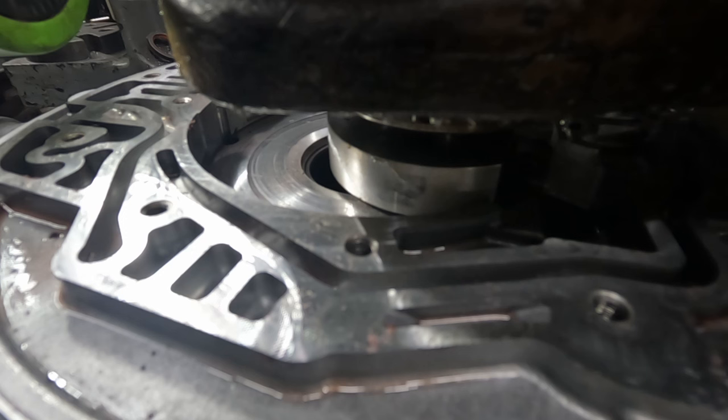So it took me a little while to try and position the camera in a space that we'll be able to see stuff, but there's not a lot of working height on these Van Normans. So I've got to keep a really short squat fly cutter, and then of course that's down in a pocket, so it's kind of hard to see, but I think we're going to get it here. So let me turn on the mill and try to touch off to find a zero and probably add maybe 4 or 5/1000ths for a depth of cut.